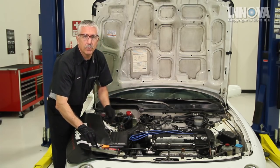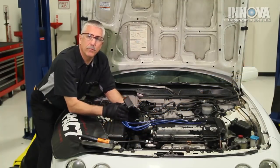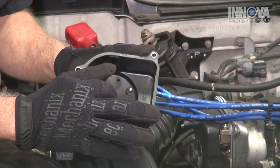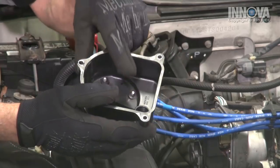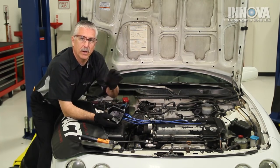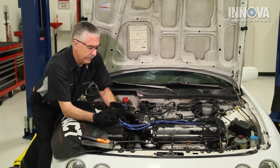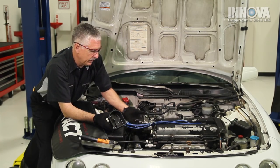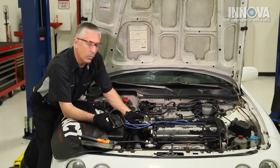So we're going to begin by removing the distributor cap. We've removed our distributor cap screws, and on a visual inspection, we've noted that there's a lot of corrosion on the contacts. Those corroded contacts give us more clearance between our rotor and our contact points of the cap. That, combined with the spark plug gap, will create more of an area, and the voltage will be high — that will be an intermittent condition. We've visually inspected to make sure there are no contaminants inside the distributor, such as oil or water. If we suspect there's oil soaking inside of the distributor cap or the bottom of the distributor, we need to address that now, but that looks okay.